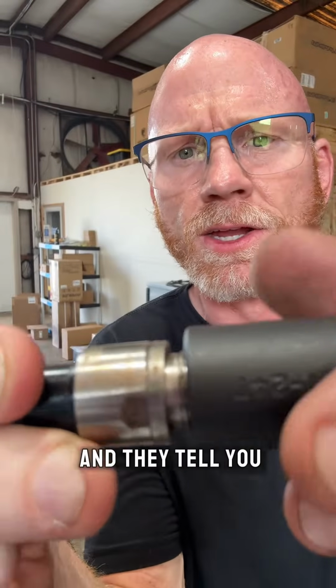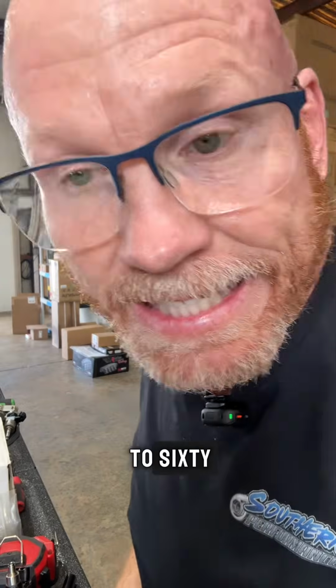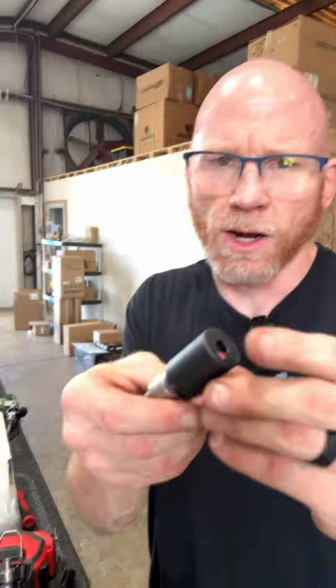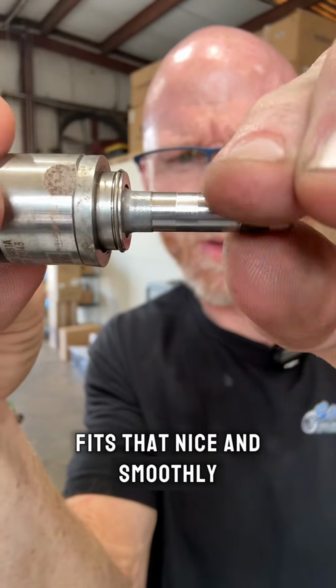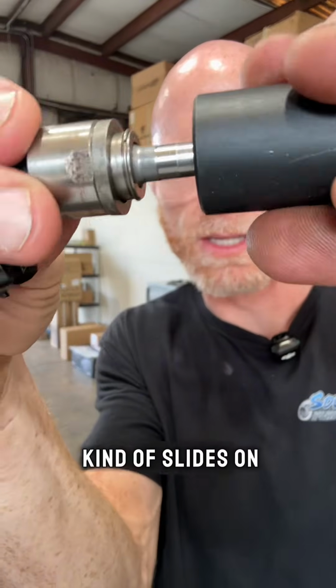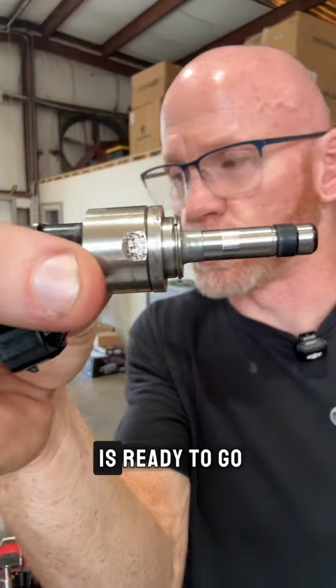So you slide it and they tell you to turn at 180. So we're going to turn, then we're going to count to 60. But with the magic of video editing, we're going to skip that part. A few moments later. All right, it's been a minute. So now we take and turn 180 and pull it off. And now you can kind of see, now it fits nice and smoothly. It still moves around a little bit, that's fine. But now the sizer kind of slides on pretty easily and slides off. So now that injector is ready to go.